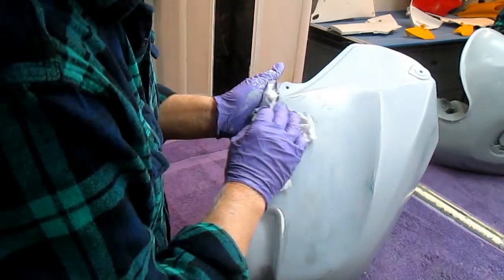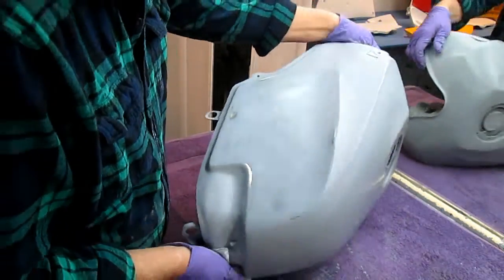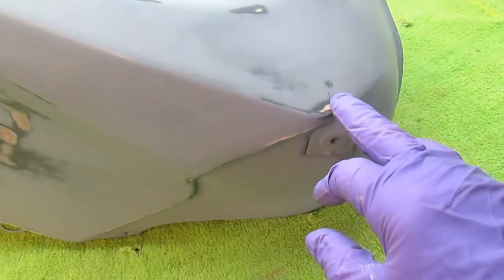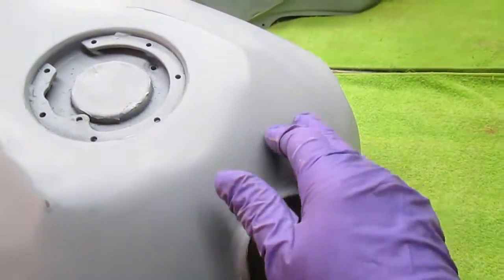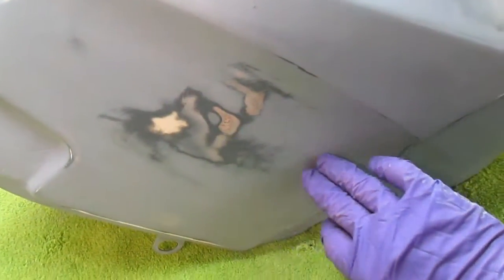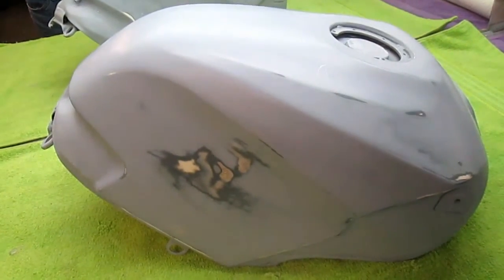But now I can see this side may need an extra coat of primer, so I may as well just sand the rest of this down because we have the time today. And at the end of the day, no matter how cold it is out there, get another coat of primer on this. I'll feel better about it anyway. Now, all our extra efforts have paid off because we've picked up a lot of the high spots that you really didn't see. This spot here, and it's just going to be in my best interest and in Steve's best interest. Now notice, our part came out reasonably well. I'm not bragging or anything, but the bodywork from this Bondo work really is. I really worked on that for quite a while too. I really wanted that to be nice. And hopefully it's warmed up enough out there that I can get to prime this in the next half hour or so. I'll wipe it all down, tack rag it, and it'll be ready, and I hope it's above 18 degrees.